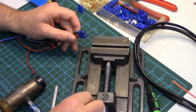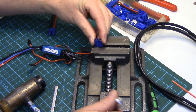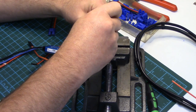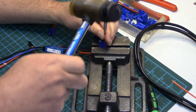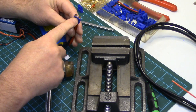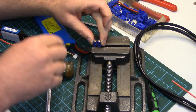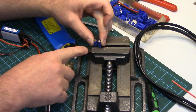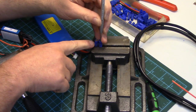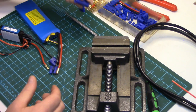If you ever have to get these pins out, what I do is use my vice again and open it up just so the shoulder of the connector is supported by the edge of the vice, so the wires are free to move but the edge of the connector is supported. Then I just get a small drift punch, get my hammer, and give it a whack — that'll snap the pin out. Same thing for the female end on a battery: have the vice in enough so the edge of the connector is supported, then use a small drift just small enough to fit inside the female bullet and tap it out.